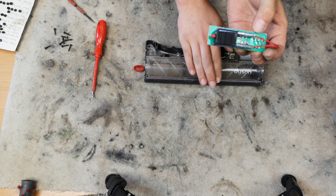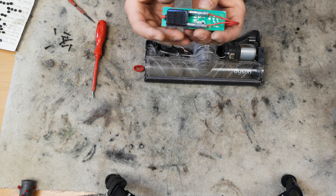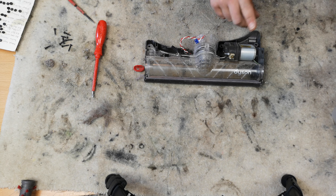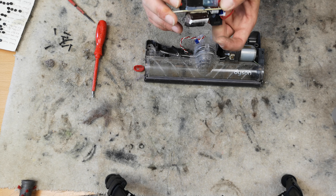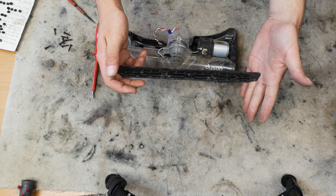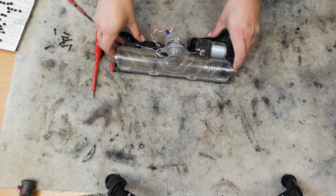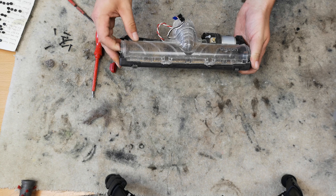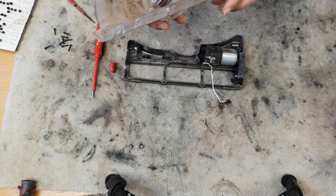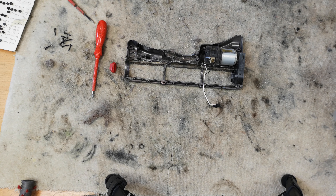If your brush roller stops on a DC24 - which is tremendously common, like stupidly common - this is going to be a combination of either this or this, normally that one if I'm honest, but this has been known to fail too. This one's alright though. We can take the bumper off because two of the screws were for the bumper, then lift out the actual brush roll housing itself, which is always going to be utterly, utterly disgusting.